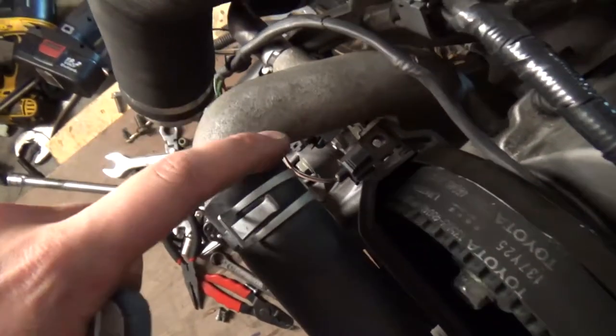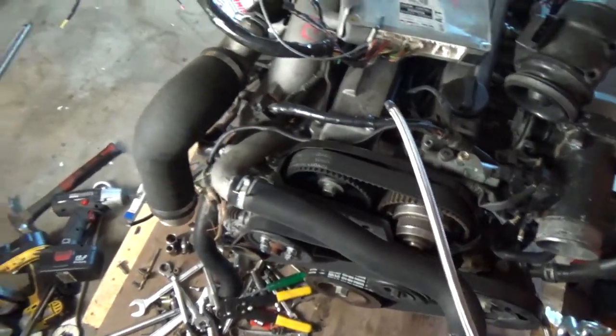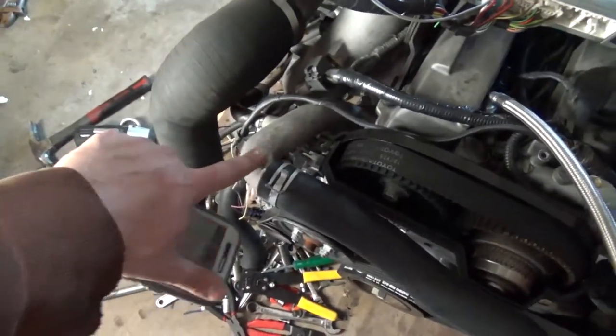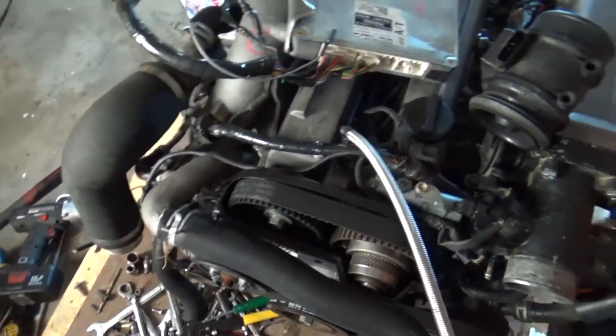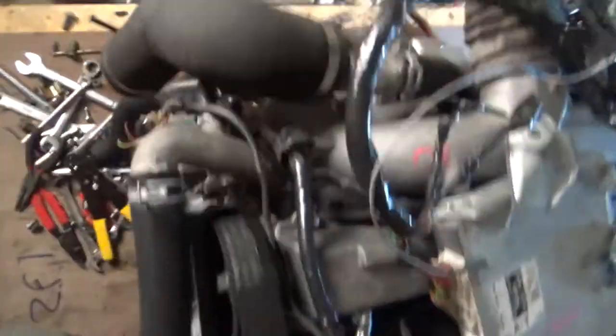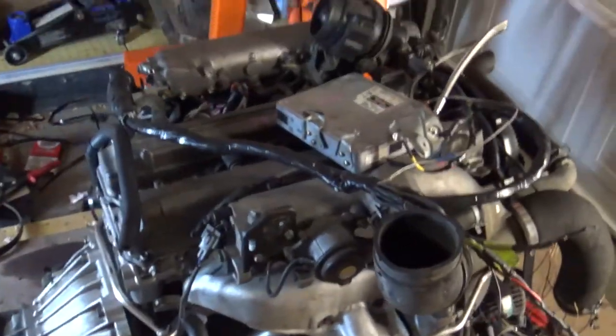The next part I'm going to cut these off — I don't like this stupid cross connection because it doesn't make it easy when you want to take stuff apart from the front of the engine in the car. You have to take all this coolant stuff out. So you just cut this little neck with a sawzall or an angle grinder, and do a KA radiator. Luckily they sent me this hose on here so I don't have to put a giant truck hose on there that doesn't fit.